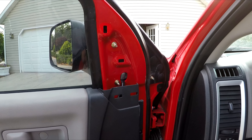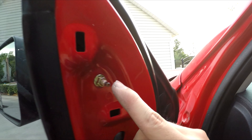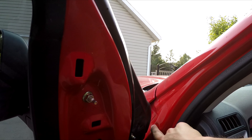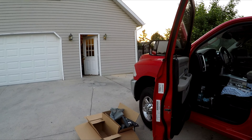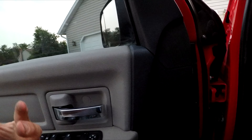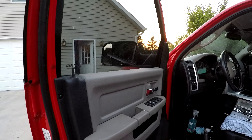This is exactly why you don't buy eBay tow mirrors for your truck. This bolt right here — the screws are pretty long, all of them. Every time you'd open the door you'd hear it scratch and grind, and I even accidentally chipped up some of the panel. I decided to take the screws from the old mirrors and install them on the tow mirrors — had to take the door off and everything again. Now I have the old bolts on — see how short that is? No scratching is going to happen. Let's get that other mirror on.